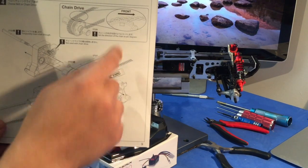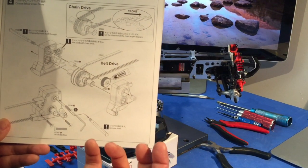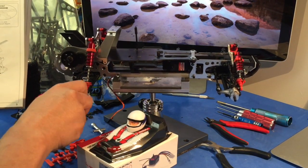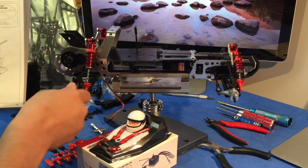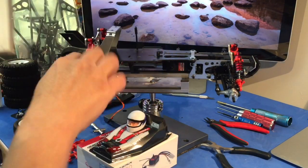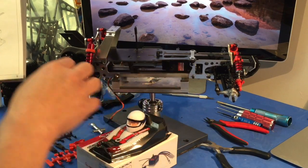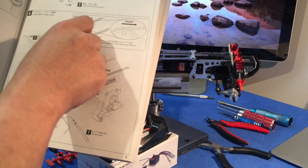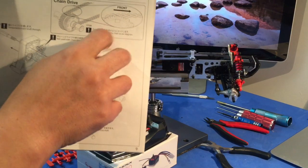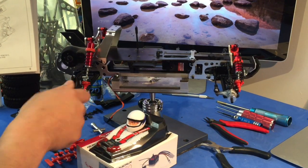I don't know why it has to be like this, but when it was built opposite, like when I initially built it, it was harder to turn. The wheels, when you do this, it wasn't smooth. It felt some type of friction, which is kind of weird. It didn't feel right. So I had to take the front and rear gearbox apart and whatever was in the way. I had to take the chain out and turn it pretty much inside out so that it is oriented in this fashion here. And then once I put it back together, it became smooth like this.